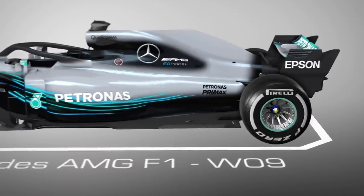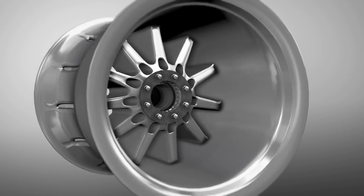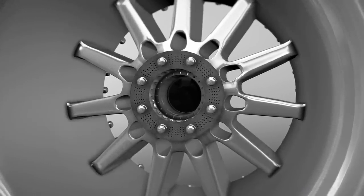It's probably easiest to just follow the airflow. Like any rear hub, you have the airflow going through a duct, which is usually used to cool the brake assembly. They're also using it to blow through the little locating holes that usually exist on the brake assembly — these are there so that when the rim is being put on during a pit stop, you have the little locating pins and you're able to put the wheel on quickly. There are more holes than there are locating pins.